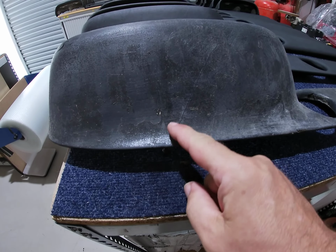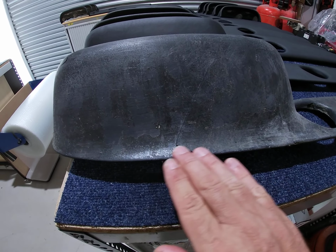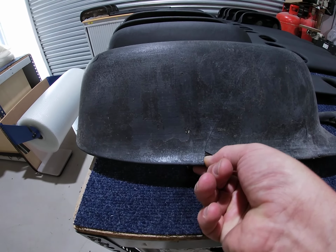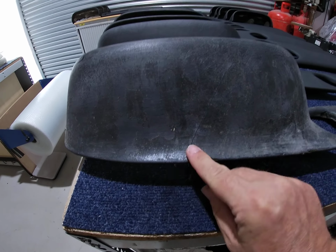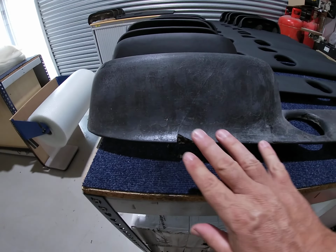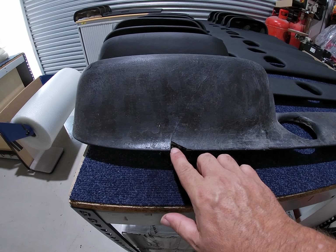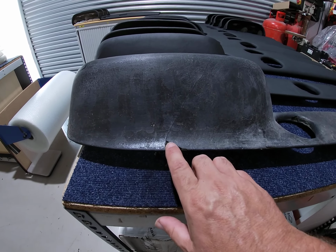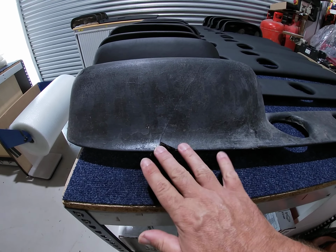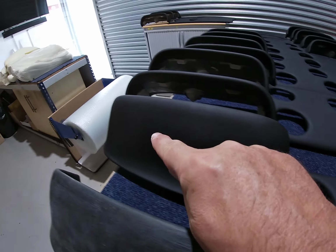So what we would do is we'd cut that right back, strengthen that, hot wax it, and then a really light skim of filler over the top, because body filler and this will not go. As soon as it gets any vibrations, it will just come back again. So if you're having your dashboard filled thinking you've got a miraculous plan, unfortunately it won't work. Give it a week, 2 weeks, a month, or 6 months, that crack will start to reappear. You've got to do it properly, and the only way to do it is by reskinning the whole dash like this.